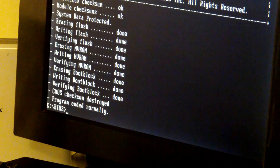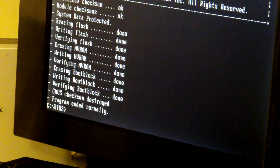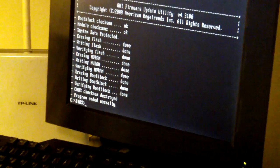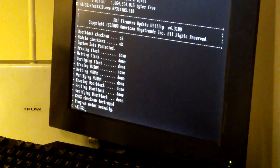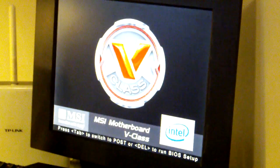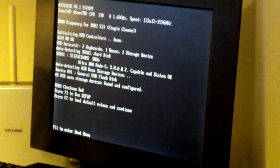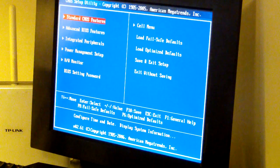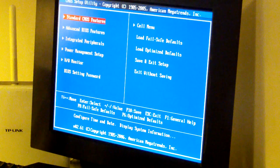And you just leave that in here, and let's try to reboot the system and see if it gives us a normal BIOS screen. Control Alt Delete. Yes, it does. So, whoops, it's fast. F1 to enter setup. And we have a normal CMOS setup that we can use. So let's try to have a look there.